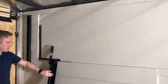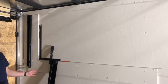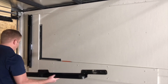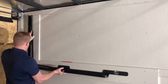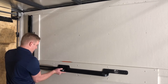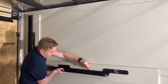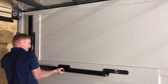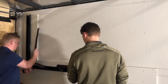For this next step, we're going to be installing the bottom shelf bumper bracket. It's helpful if you have two people on this — one to hold it, one to set it square, mark it, screw it in. With just me, I'll show you how to do this by yourself. Slide it into place off the back, set your framing square down, get it nice and square to itself. When you're happy with it, go ahead and mark that height in a couple of places as reference. Check and make sure you're happy with the square again, then go ahead and install. Put it into the pocket here, then check for square one more time.